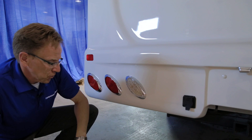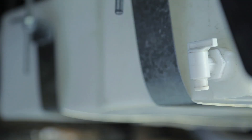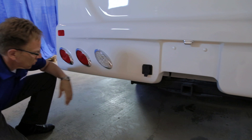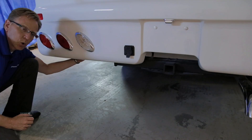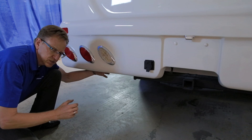To drain your fresh water tank, located between the hitch rails on your vehicle, find the drain valve on the driver's side near the hitch rail and open it. Also in this area, just behind the brake light, you will find your low-point drain valves for both cold and hot water lines. When draining the cold and hot system, you will need to have taps open inside your vehicle so that air can enter the water system for a proper flow out of your low-point drains.